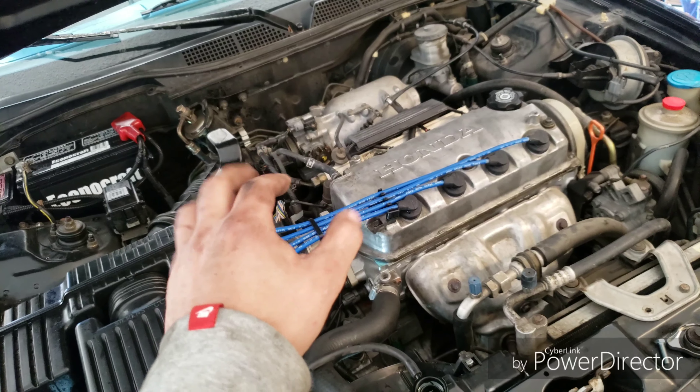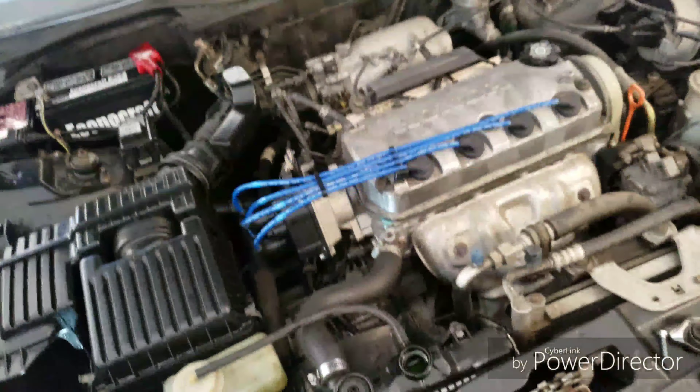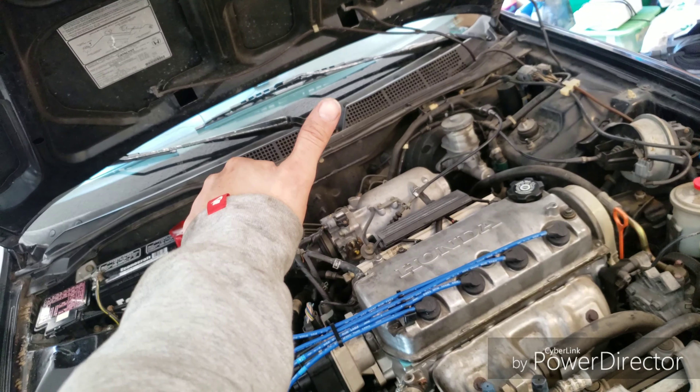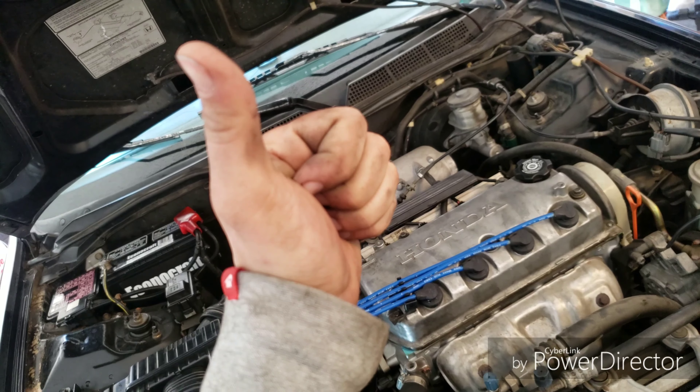I added some coolant - obviously the water pump needs to suck some in. I'm going to turn it on with the thermostat cap off so it won't hold any pressure. If there's any air in the system it's just going to bubble out. I already have a light on the bottom to see if there's any leaks. To get the air out of the system, go inside the vehicle, turn the heater on at full blast with the cap off, and just keep adding coolant as it goes down. There'll be bubbles at first - don't worry, that's what you want to see. You should be good to run. Thanks guys - subscribe, like, let me know what you think, and I'll see you later!